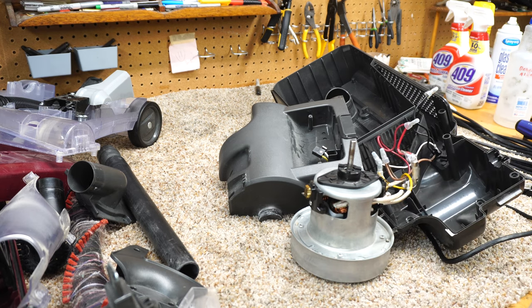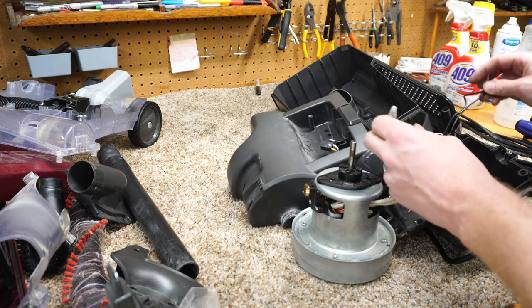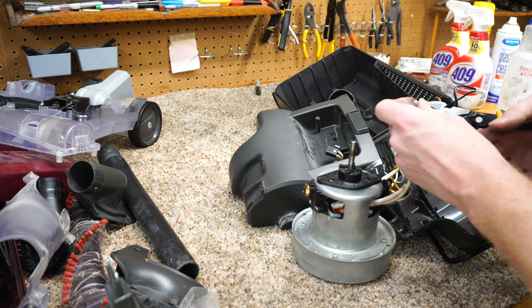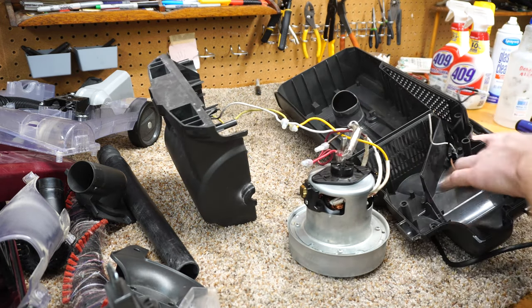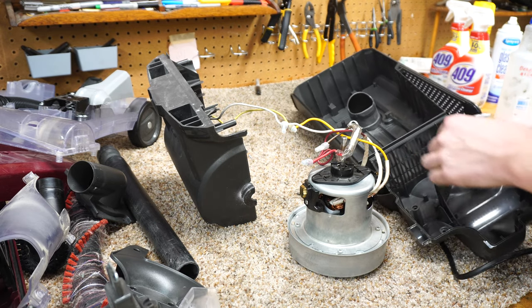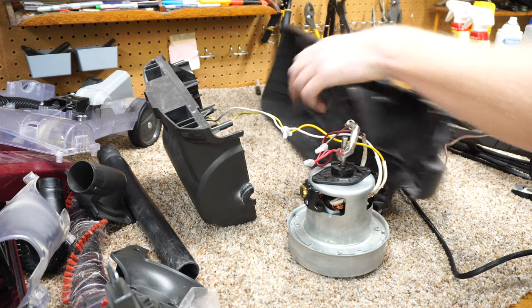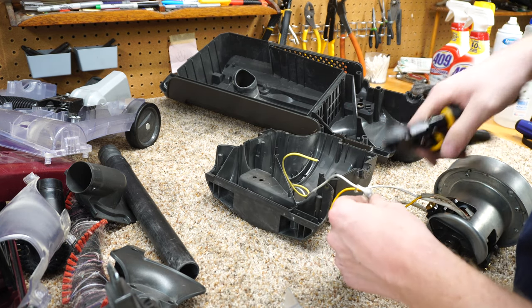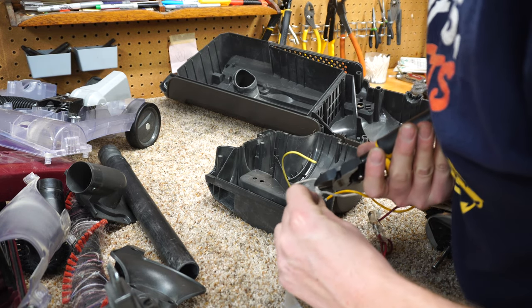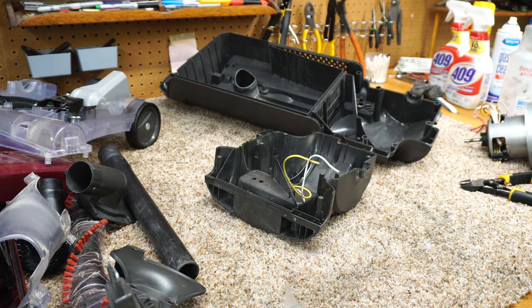If I just snap a picture of that, just to be on the safe side. But all this really kind of makes sense when I look at where it's going to go. So we want to pull select wires out of here. Brown gets cut, and the white gets cut, and everything else starts to pop out all on its own, really nicely, hopefully. Small repair here, and cut our yellow lead, and we'll cut a white lead. And again, if you're ever unsure about wiring something, leaving some evidence behind like that is nice.